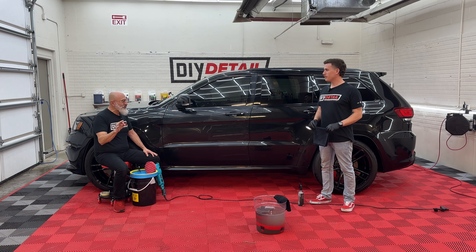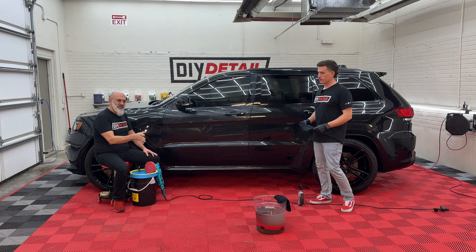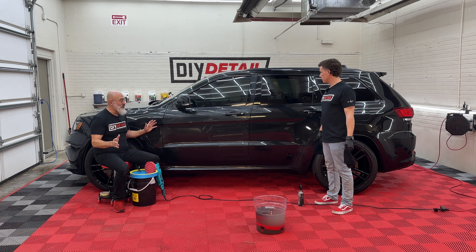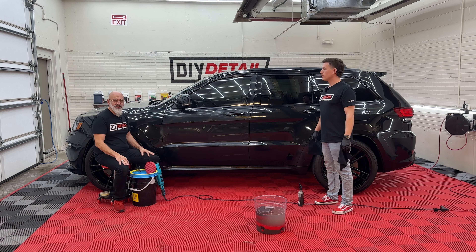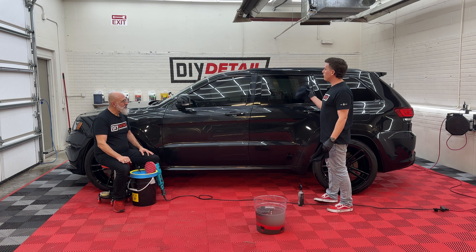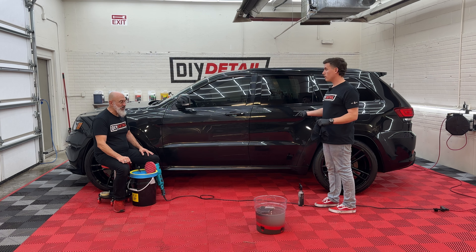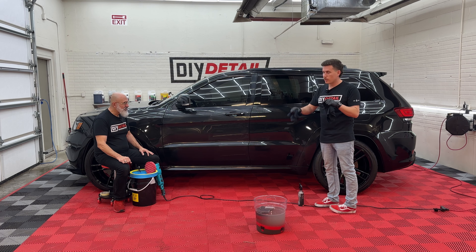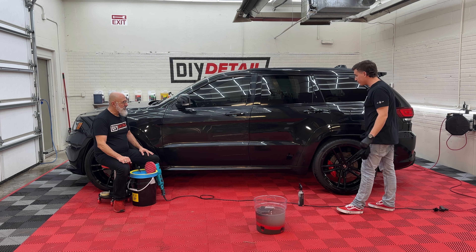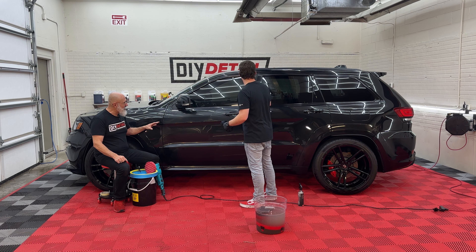Nick is being super efficient — he's using the panel prep at the same time, wiping off the polish residue with the damp towel, going back with the dry towel, and then the panel prep. We're ready to coat as soon as I'm done polishing and as soon as he's done wiping. It feels sort of slow to me as the polish guy, but as he's removing it and prepping it, it's nice — because as soon as he's done, we're going to coat right away. Not a bunch of 20 minutes dialing in the corners — the panel prep has already been taken care of.